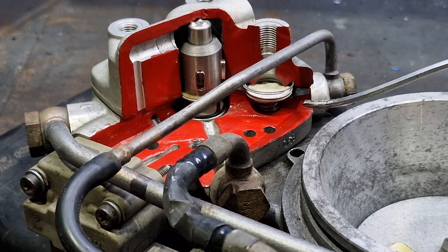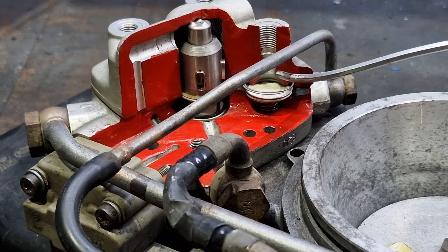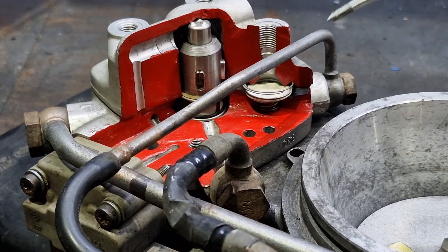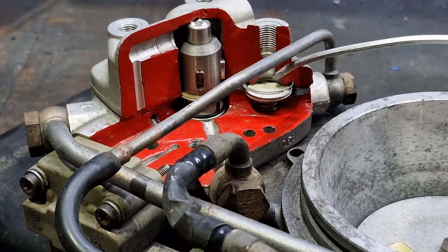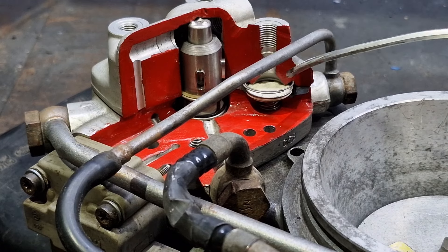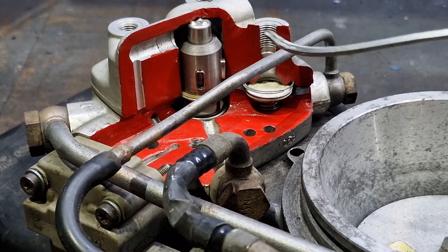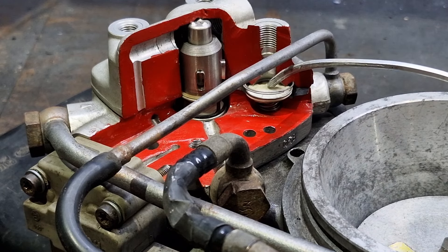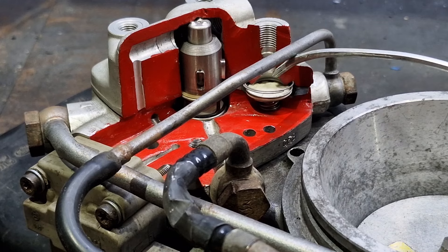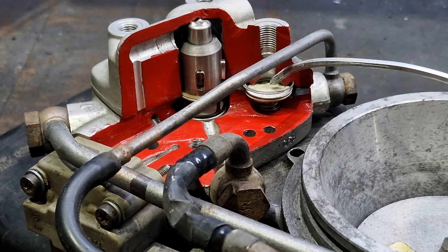Zoomed in, you can see more detail on the springs. There's a rubber diaphragm in these types, and a platelet that sits there. A nozzle sits on top of this and sends fuel out — when the platelet is in the down position no fuel from the injector can get out. The fuel plunger in the middle of the fuel body works on the same principle as K-Jetronic: the air plate moves up, uncovers the slots inside, sends fuel into the chambers, and as that spring moves down it uncovers the injector so fuel comes out the top.